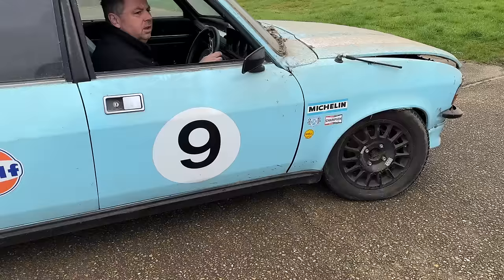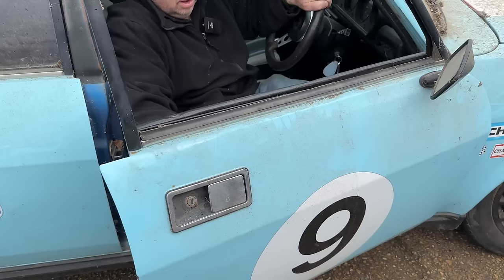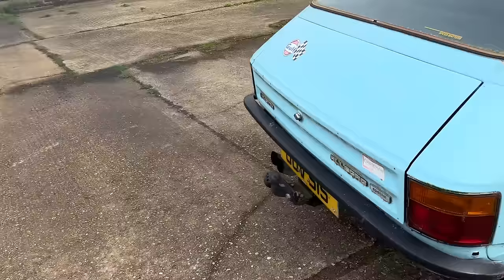Ah, I see what's happened. It's the wheel arch. On the wheel? Yeah, look. Because it's wonky on one side because of the hydrogas, I presume. Yeah. It's rubbing the wheel arch on the tyre, look. That's what it is. There, oh, look. Schweppes. Because look, if you look at the back. Yeah, no, I can see it, Claire. I don't need to look at the back.